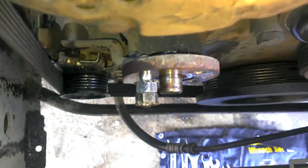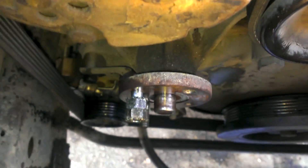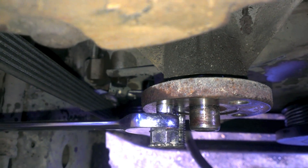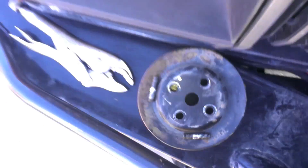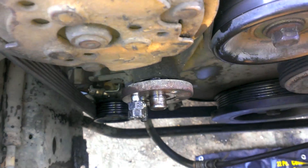If you were curious about how the stud removal goes — you take two nuts, thread the first nut on just about all the way, then the second nut on top of that. Take two wrenches — in this case two half-inches — tighten them together so they're locked, and then all you do is loosen them back up. Going like this gets you in a good angle, now the stud's turning instead of the nuts. Locking the nuts together holds them on the shaft, so you can just sit here, loosen it up, and the studs come off. The one that comes off fine is easy; for the other one you're going to have to use a vice grip to hold the part so you can get the nut off the shaft. Stud removal 101, cheap trick.